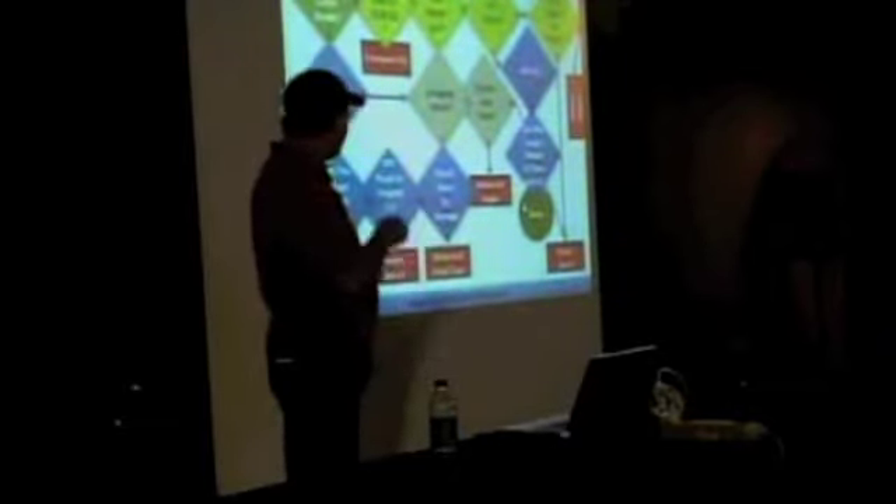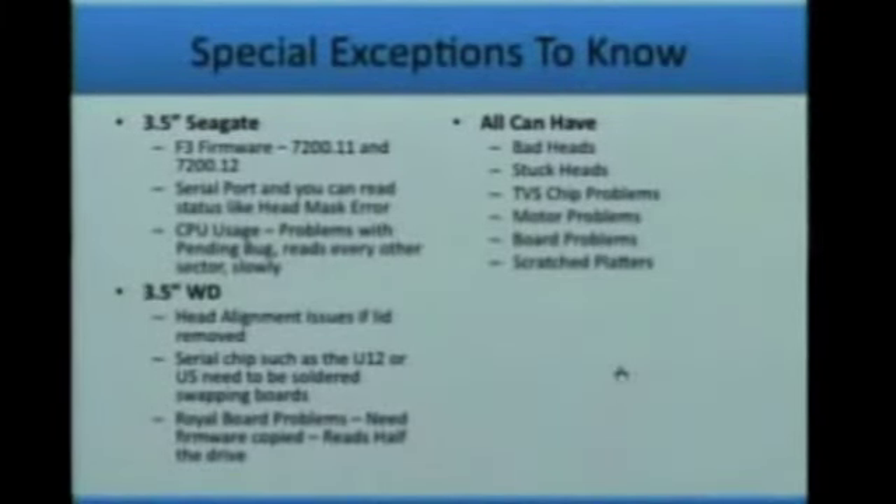These are some of the exceptions I want to talk about. For instance, if I have a Seagate drive, normally anything before December 2008 I might start doing basic diagnostics the same way for all drives. But there are exceptions. If I know I have a drive labeled 7211 or 7212, they have a specific firmware problem that exhibits in two ways: one is I can read a serial number but I don't get a size, and the other is that the drive always stays busy and never comes ready. Those are two symptoms of a firmware failure that would normally not occur under other circumstances.